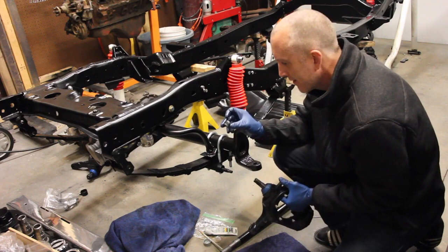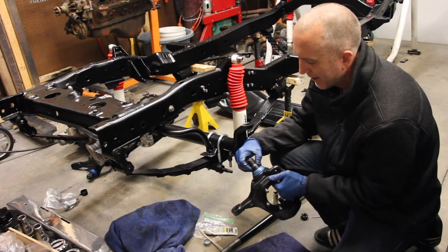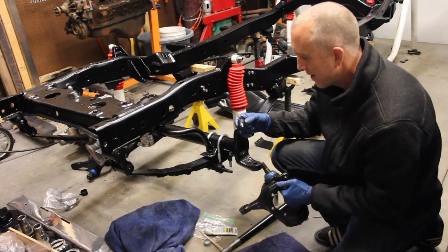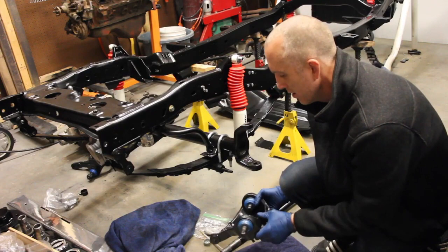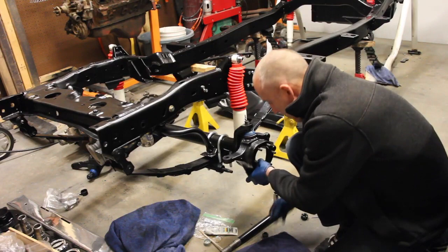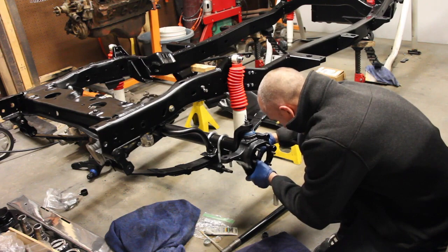When I first took this apart, I thought this was threaded onto the actual ball joint, but really there's no threading — it just slides over the top. So when you're taking this thing out, you don't need to unthread it; you just need to pop it down through and take it off. Get the steering knuckle with ball joints pressed in, start from the bottom, line it up, and slide the bottom ball joint post up through. Apply the nut to the bottom and hand tighten just to hold it in place.